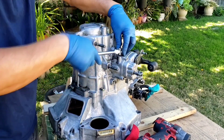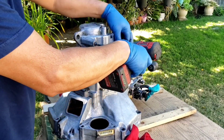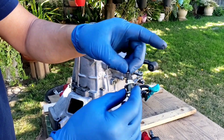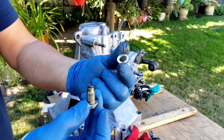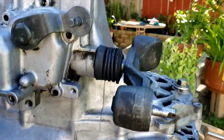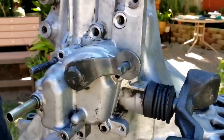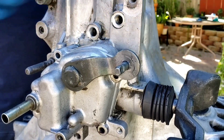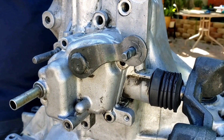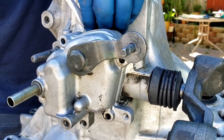So what I'm removing now is the retainer screen. There's that spring right there. You can buy this spring from Speed Factory if you want a little bit of tension. It has a seal gasket — aluminum. The check ball is still on there, so you need a magnet to get it out. I'll just give it a tap and it comes out. Make sure you don't forget this one — I'm going to put it on the plastic so I don't lose it, especially out here on the lawn where it's easy to lose parts.